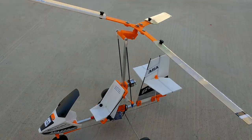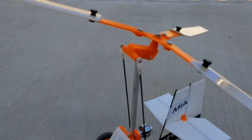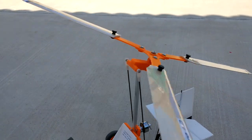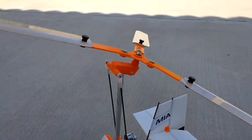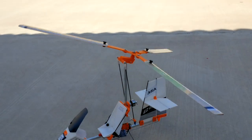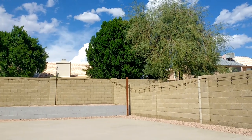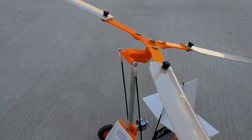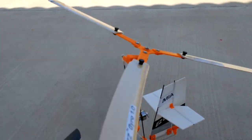This particular gyro uses a trademark head — the MIA trademark control head. All the mechanics are hidden away; you cannot see any of the pivoting mechanism, which is basically a yoke or universal joint designed as part of that head. You can see the rotor head is just spinning by itself from a very slight breeze today, which is an indication of how well this rotor head is built. It's a dual-plate, dual-bearing design with blade saver extenders.